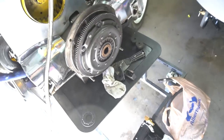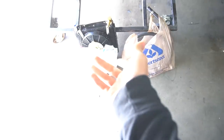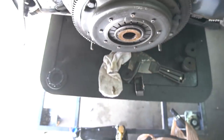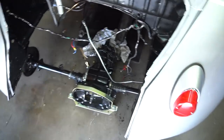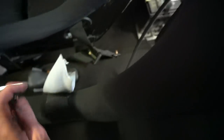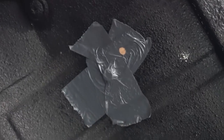First things first, I'm going to mount the oil cooler and get all that sorted, then put the trans in. This is what building a car by yourself looks like: when you have no one on the inside to hold a bolt, you have to get that bolt really tight around duct tape so you can at least get some threads started, and then come back and tighten it properly later.